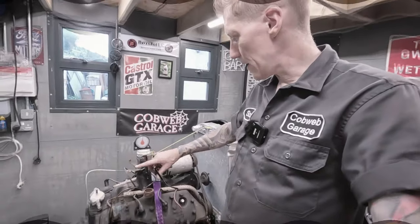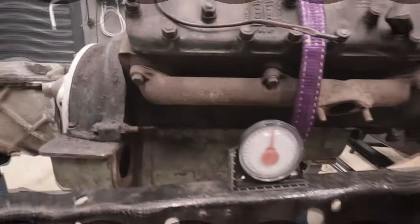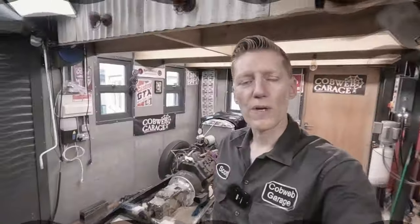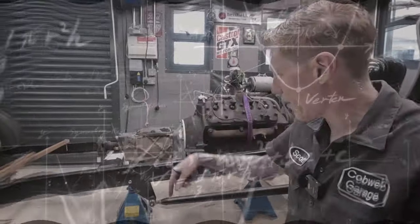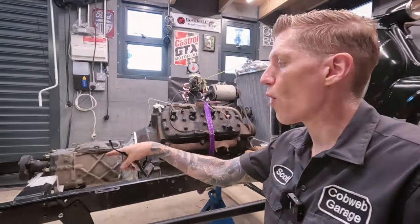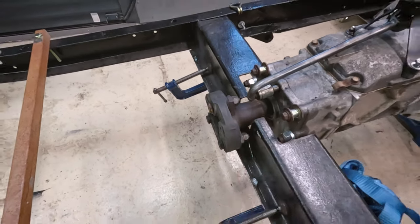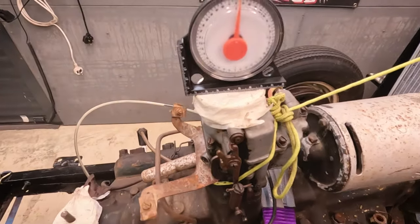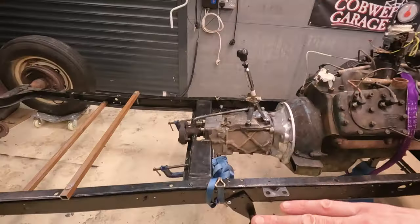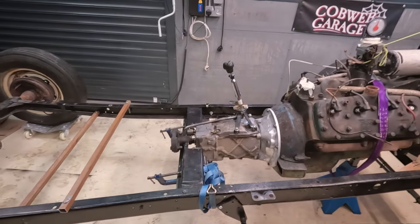There's two degrees out now, plus another three — the engine is at about a one degree slope. So that's six degrees — the frame is at about three degrees the wrong way. We should tilt that up, and I'm looking at probably three degrees right downwards, which means the engine will need to move five degrees down. The gearbox there needs to go down — we need to cut more out of that crossmember. I've just chopped down into this old crossmember a little bit further and that's let the gearbox sit down. We've got maybe six degrees the wrong way and we know the frame is about three degrees that way, so when the frame sits at the correct angle of about three degrees, that engine and gearbox will be about right.